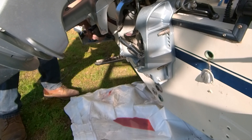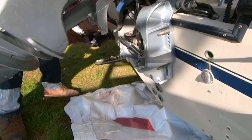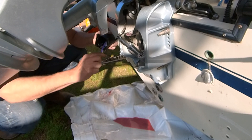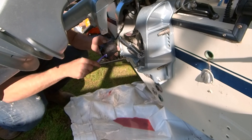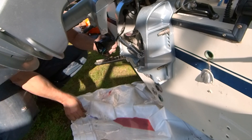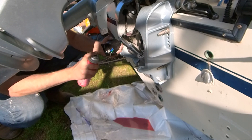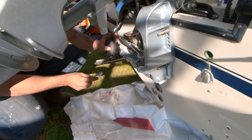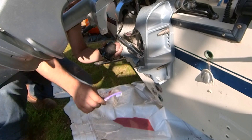The whole spray here is black — you can see this, it's pretty black. That means a lot of residue from the old one. You know what that does? It prevents the magnet from making a proper contact — so that's another thing that can stop this from working. Brake carburetor cleaner is the best, it cleans everything very well and dries fast.